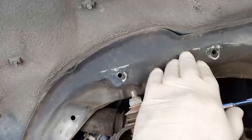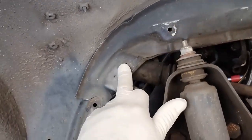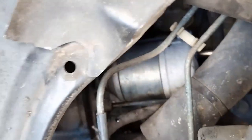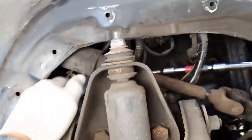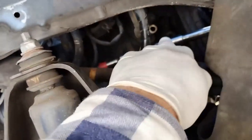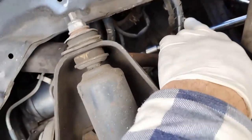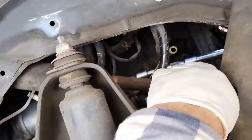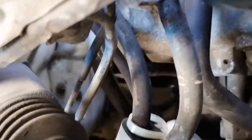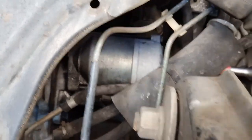Now that we've removed the skirt — I did break some of the plastic plugs but I got some more — there's the starter motor there. I'll just show you: you can't really pass your hand through anywhere other than around about here. I've disconnected the ground wire for more working room, but it's very tight in behind there. I'll try to get the camera around a bit, but that's about all I can show you from here.